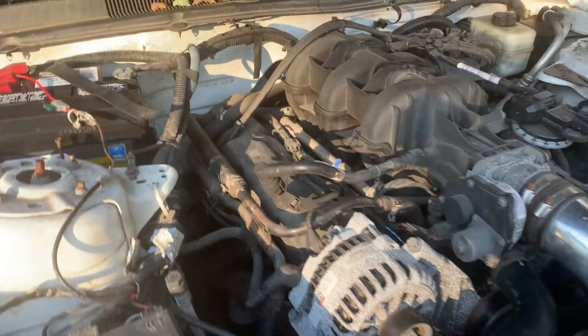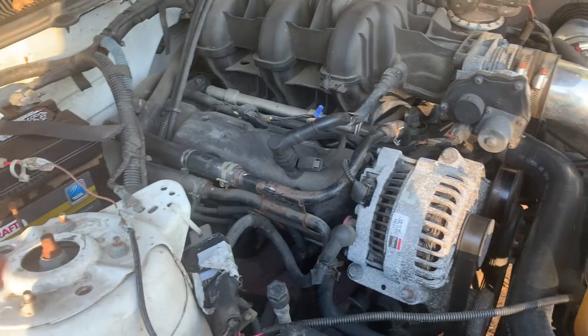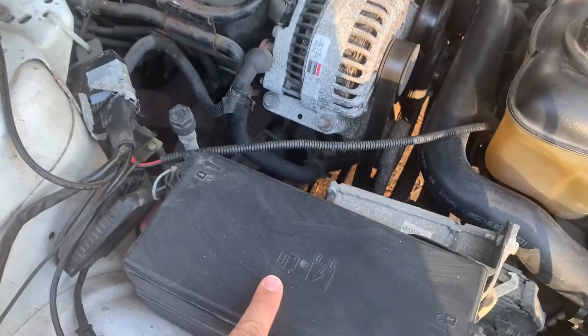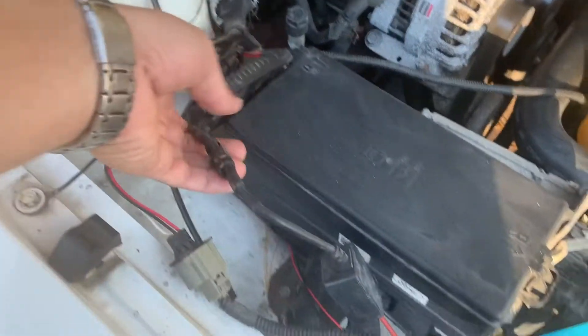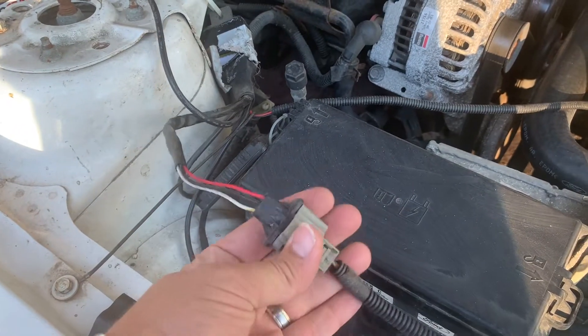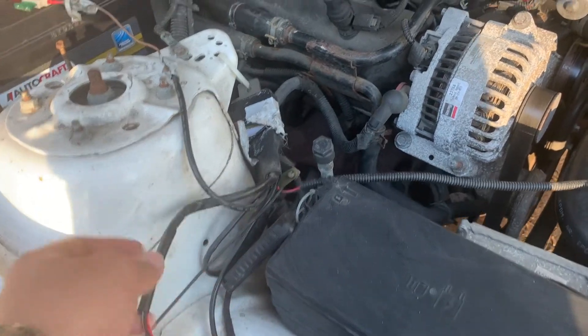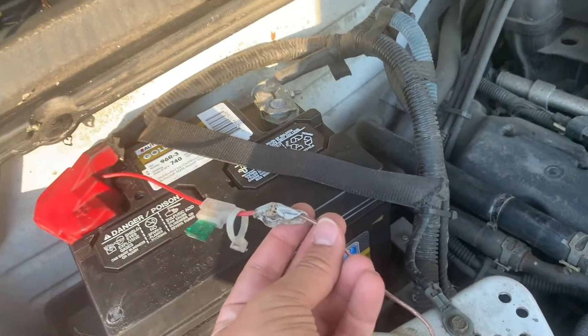When I was talking about some of the wiring, what you'll see is there's this wire here — that's the power that goes straight to the battery. What that person should have done is actually mount it right here to where the relays and fuse box is. We've just got random wires hanging here. I believe that this is our front headlight one, this part that I'm holding here. This is the power for the other one. As you can see, this just kind of came apart, and this is what I was talking about — that looks melted with an inline fuse there.